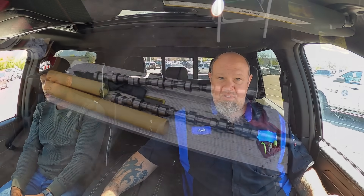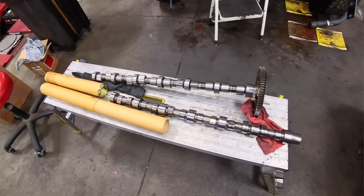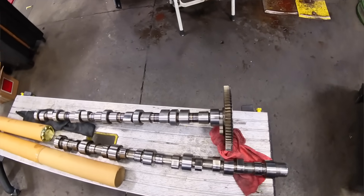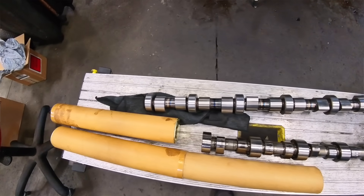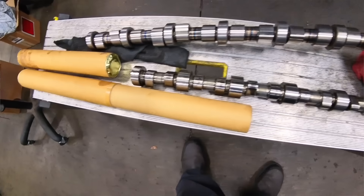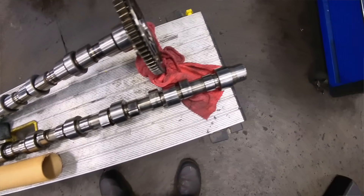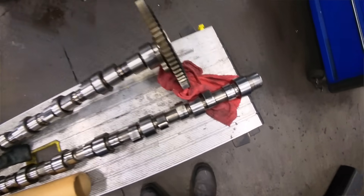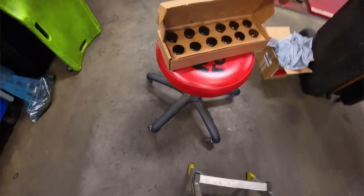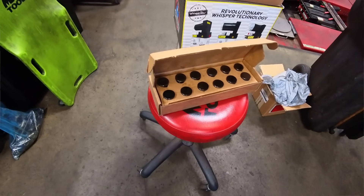What they want is these trucks to last for a long time. So we had to eliminate all the stuff that potentially breaks. Everybody out there who has a fifth gen knows that the cam and lifter combination is the weakest link. So we reached out to our buddies over at Hamilton Cams, and we got two camshafts and lifter combinations - camshafts, lifters, pushrods, and rocker arms.